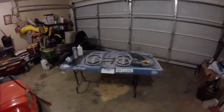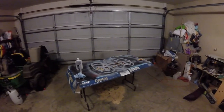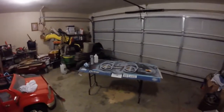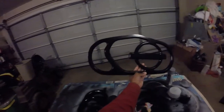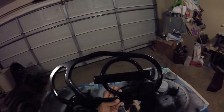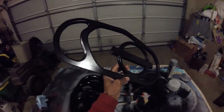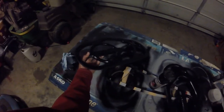So I'm going to go ahead and spray the black this time. It's primed and ready - I'll spray that black coat. I'll probably do two or three coats before I call it done, and then it'll be time for lights and the grill. Alright, the black is sprayed and I think it came out pretty good. It's upside down, but this is the passenger side - it's looking pretty good. I got a few small spots, so I'm probably going to knock those down with maybe 1000 grit and spray it one more time, but so far so good. So long way from where we started.